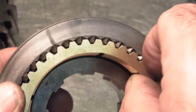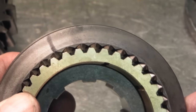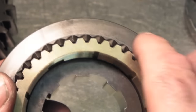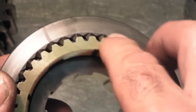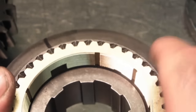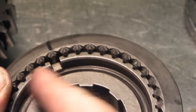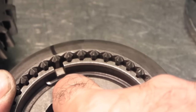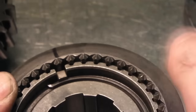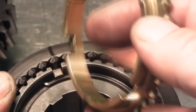When you get a block-out condition, the ring ends up point to point, and people complain that it doesn't grind going into gear but just blocks out and doesn't want to go in. It's because this indexing motion isn't working correctly — it could be the slot is worn out and opened up, allowing the ring to travel. It could also be that the key slot in the hub has been hammered out wider, causing the key to move and the whole thing to go out of index. So it has nothing to do with the actual ring being bad.